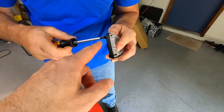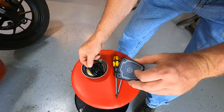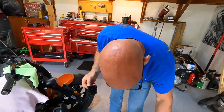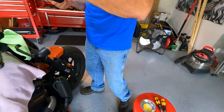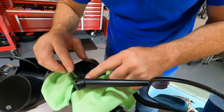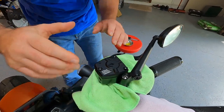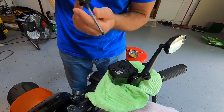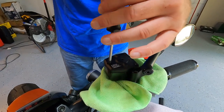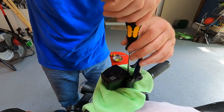You're just using the screws that came with it, attaching everything back together. All master cylinders — the diaphragm is in, which is good. We'll set this part back into the master cylinder first. I do think Harley did a good job designing this versus the Hondas and stuff I've worked on, which only have a two-screw master cylinder. I like the three-screw design. With most things, thread them in all the way around lightly before you go back and torque them down.